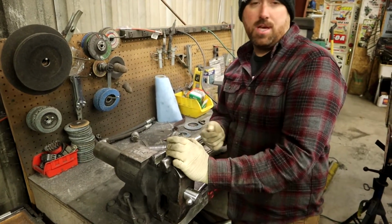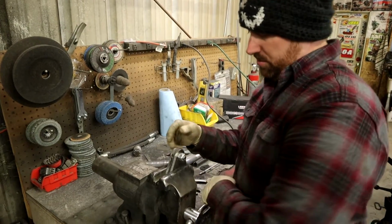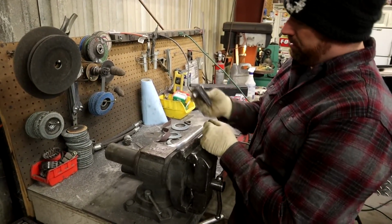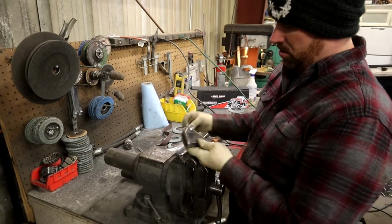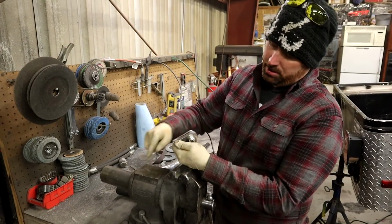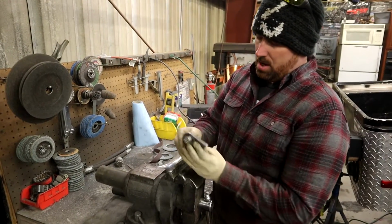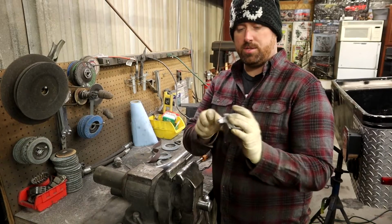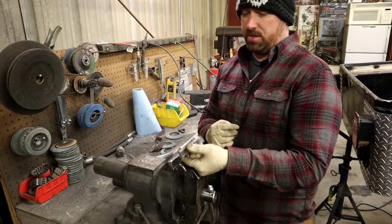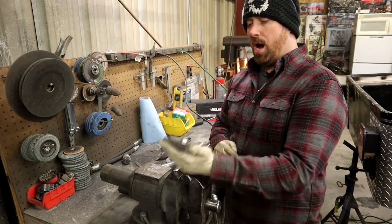When we cut stuff off the table, we always keep it if we don't use it anyways for stuff like this. But I found 4 that are all matching thickness and shape. They're a little big, so we've got to shorten them quite a bit. So we're just going to clean them, make sure they're all exactly the same. Ran a bolt through it with a nylock nut, so now these are held in place. So when you grind them, they'll all be exactly 100% the same.